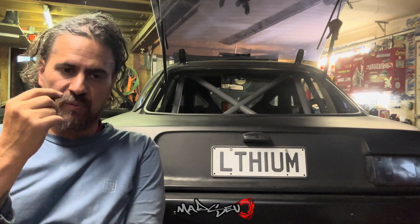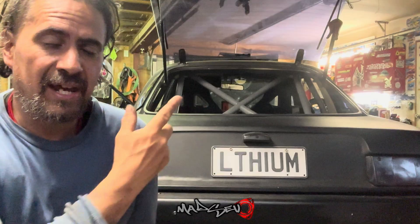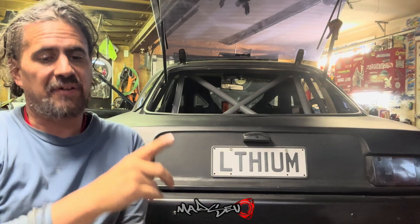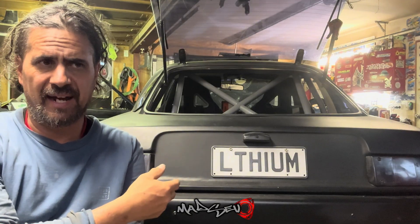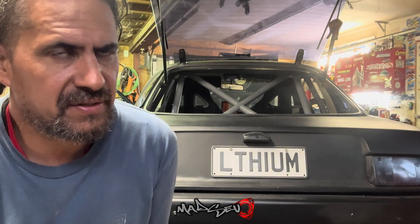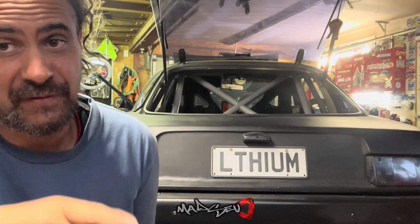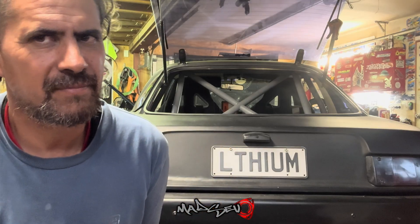Just to annoy me, I've noticed my fuel pressure gauge in the center console isn't reading. Something in the wiring behind there, but I'll sort that out — there's always something. So I'm going to end the video here. I'm pretty sure we have enough wired up to start this car — if I had my ECU. The one in it now is from the Evo so it won't recognize the trigger or the CAS, so there's no point trying to start it. As soon as I get the ECU back though, we should be able to just plug in and start it. The injectors — one's gone quiet, I might pull them out and get them tested. The intake needs polishing. I'm going to put this car to the side for a couple of weeks as I've got another car coming in this weekend — keep an eye out for that. Thanks for watching and we'll get back to this in a couple of weeks, as soon as the ECU is back. Cheers.